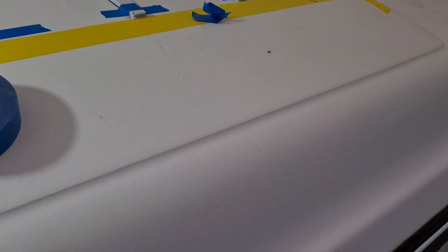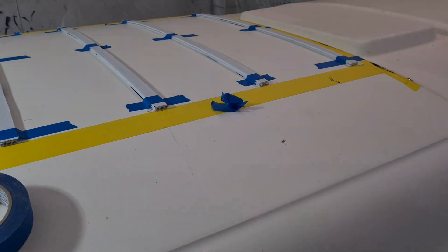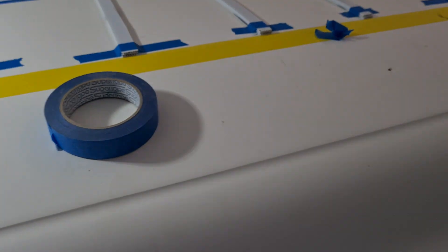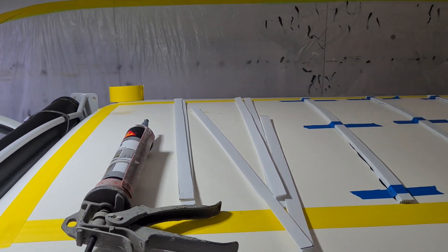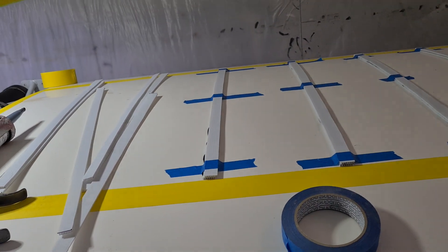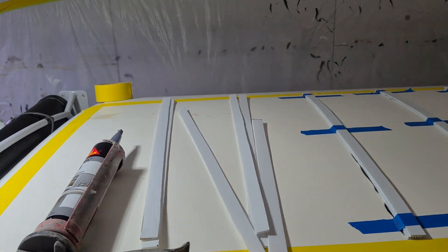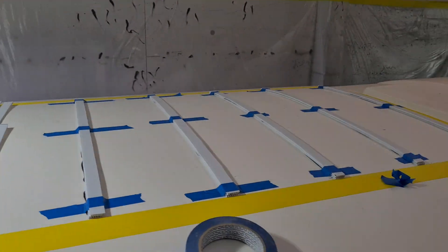This is on a fiberglass roof - sort of weird one. It's almost just bare gel coat. I think it was a new roof and it's never been painted, because you compare it to the paint and the paint's super white and shiny, and this is quite dull. When I was cleaning the bird shit off it before, it just bloody wouldn't come off - it's like ingrained in the roof. We're covering over it anyway, so I got it as clean as possible. That's something you'd have to do: give it a really good clean to make sure there's no contaminants on there so everything sticks.